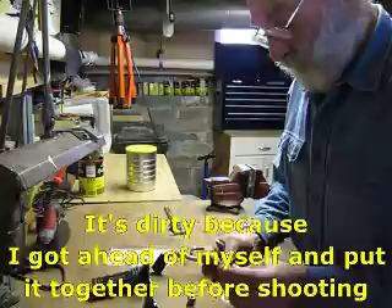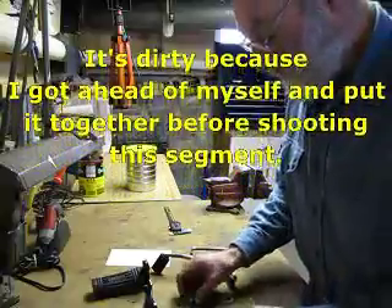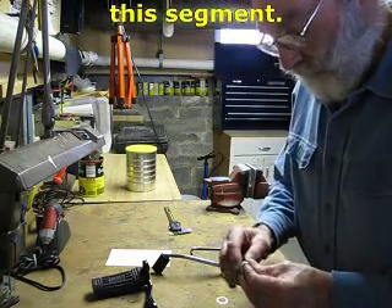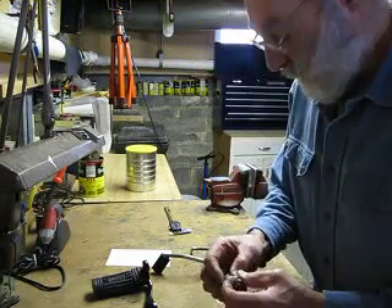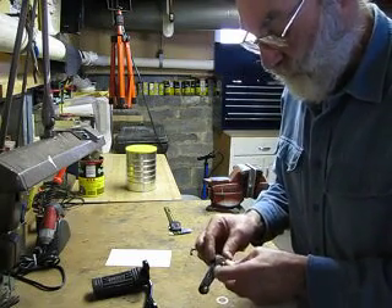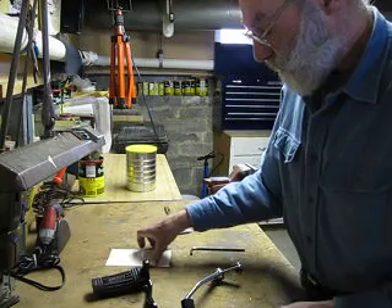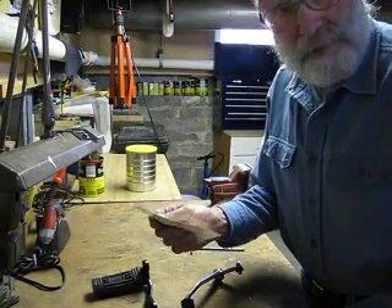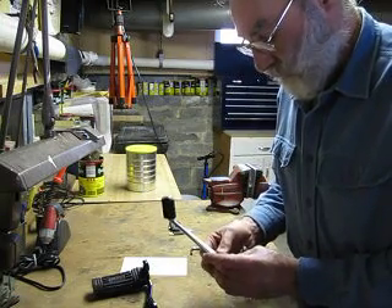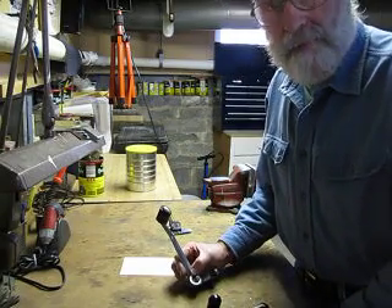Here's my gearshift pivot with the new bushing, fabricated on a lathe out of Delrin. Here's the old bushing which I removed. I want that bushing to fit tight on that pivot because I want the motion to be on the larger diameter, which makes for a better distribution of wear and also makes for a sturdier pivot. I've also used this 25-thousandths-thick industrial shim stock to make a small round shim, which is going to protect against wear between the pivot and the mount. Now we're ready to mount it back on the bike.